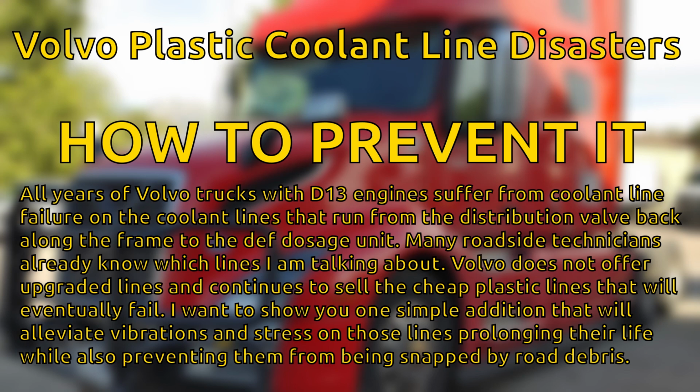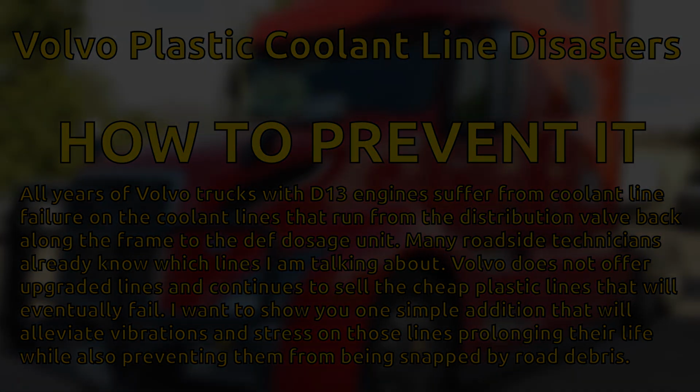All years of Volvo trucks with D13 engines suffer from coolant line failure on the coolant lines that run from the distribution valve back along the frame to the dosing unit. Volvo does not offer upgraded lines and continues to sell the cheap plastic lines that will eventually fail. I want to show you one simple addition that will alleviate vibrations and stress on those lines, prolonging their life while also preventing them from being snapped by road debris.